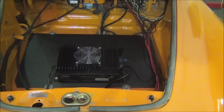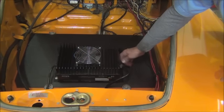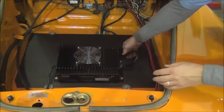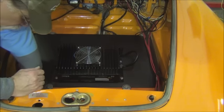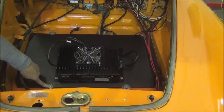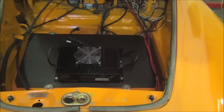Because the charger is here, we're going to have to disconnect it — and that's very simple. There are just three connections to disconnect: the connection right here, get that out of the way; an Anderson connector right here, get that out of the way; and then the power cord, which plugs in down here. So now all we have to do are these four 13 millimeter bolts, and that whole cover will come off.